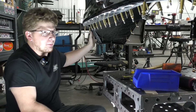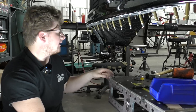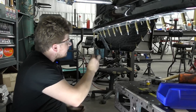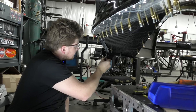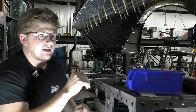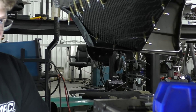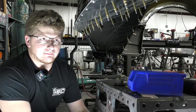I'm going to cut this out but not change the shape of the outside of the bumper, so it still looks nice and like a factory bumper, not like a chopped bumper or anything. This shape will all still be nice and radiused, but I'll just trim it right about here — maybe a little bit more than that, something like straight right here. I haven't decided 100% yet, but the main idea is to get rid of that air pocket and let the air flow out of the car without it catching and causing weird turbulence or possibly helping rip the bumper off.